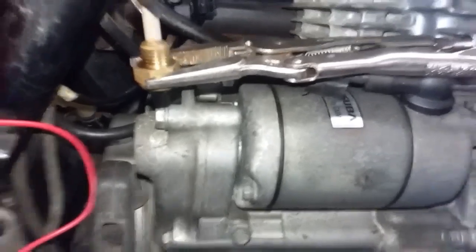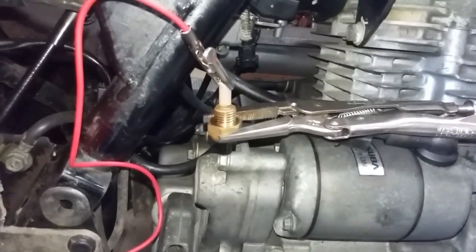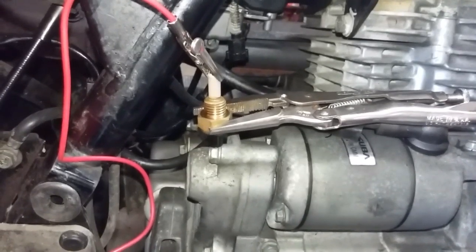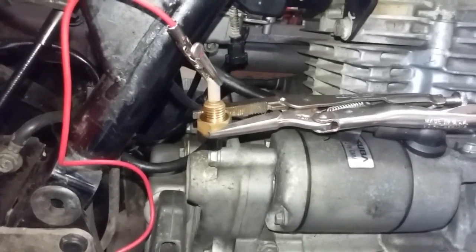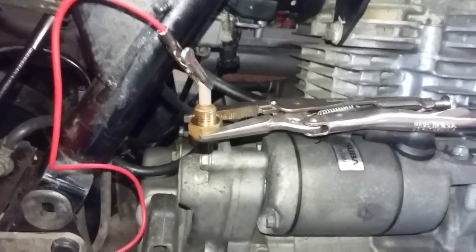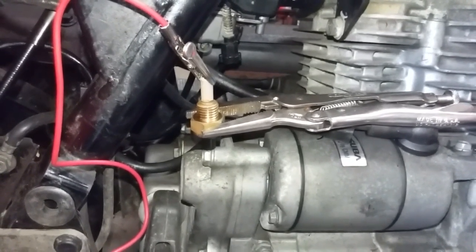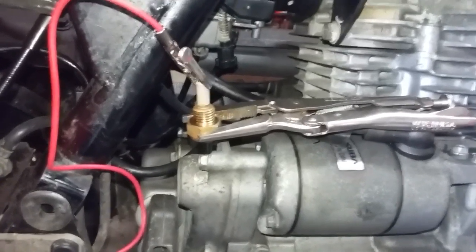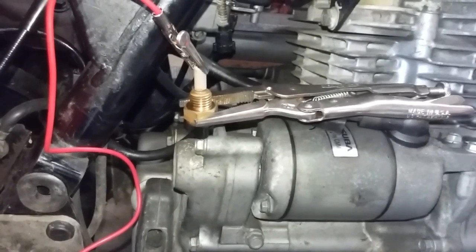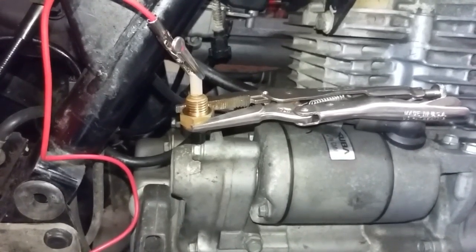If you're trying to diagnose this, obviously you don't need one of these sensors connected the way I have it — I only did this to show you how the system should operate. Basically, like I said, one of the first things you want to do is go back to that connector, put it to ground, see if the rest of the system comes on — the fan, the light, all that stuff. If it doesn't, then that's when you're going to have to go through and start figuring out the problem, whether it's the fan, the temp sensor, the fan control module, wires, all that stuff. Hopefully this clarifies how the system should work and where some of the stuff is located. Thanks.